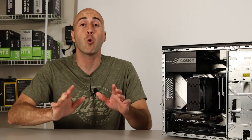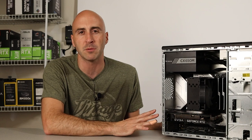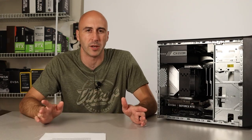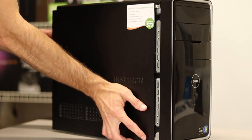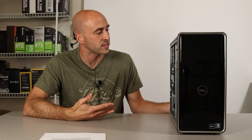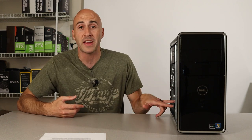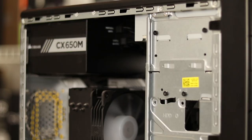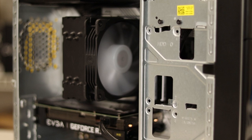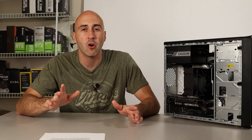That's not a bad build. Of course, this build is totally pointless. There are a few problems I want to point out. Temperatures would be the biggest one. This PC has zero airflow — there are only three fans in the whole case, four if you count the power supply. You've got the CPU cooler, two fans on the graphics card, and one fan on the power supply itself. Once you put the side panel on and you have no intake, you kind of choke this system off.